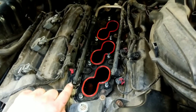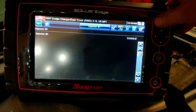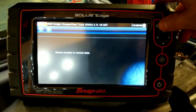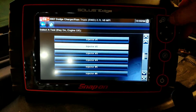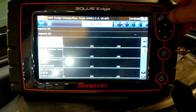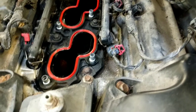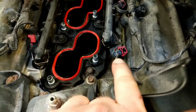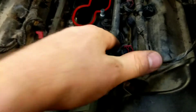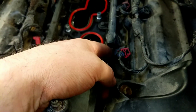So what we're going to do is compare it to cylinder two, injector number two. Go to injector two and toggle it on. You can hear it clicking. Here's injector two — you can also put your finger on it and feel it clicking each time the computer commands it on.